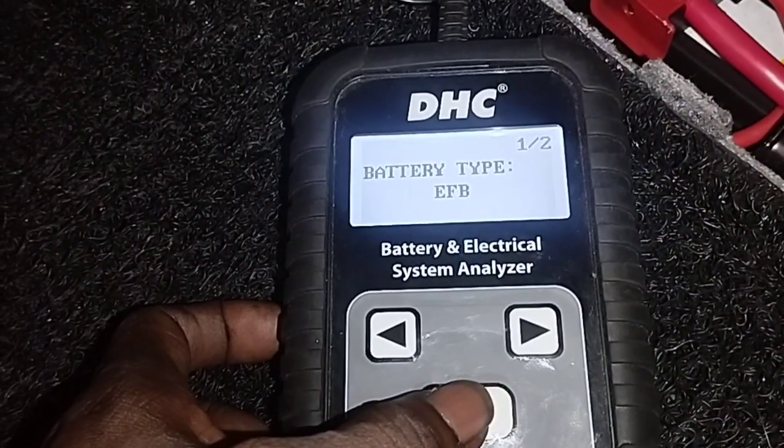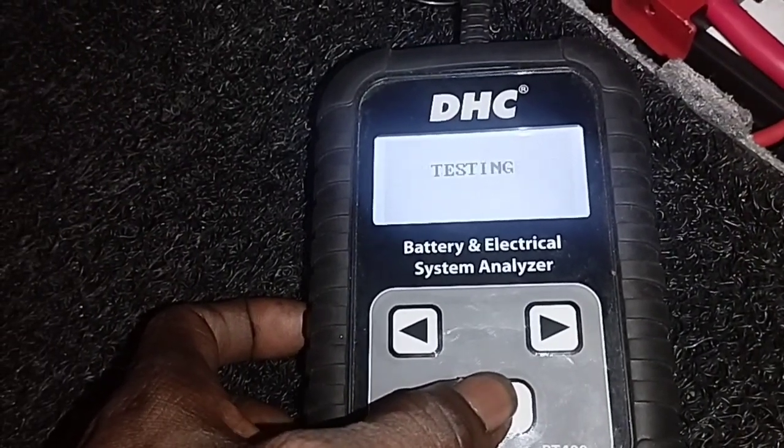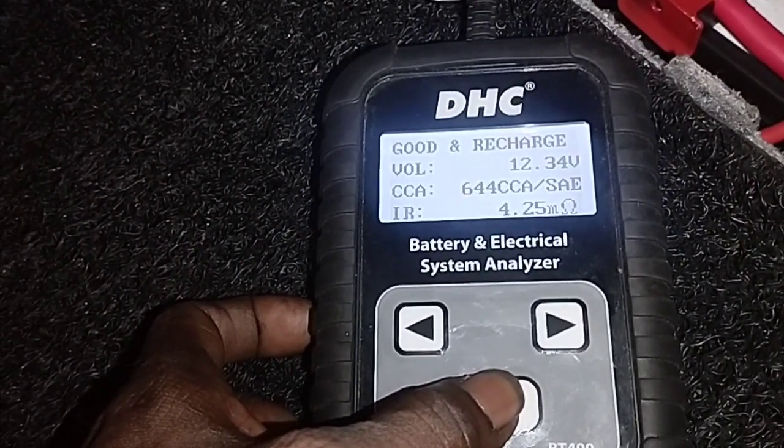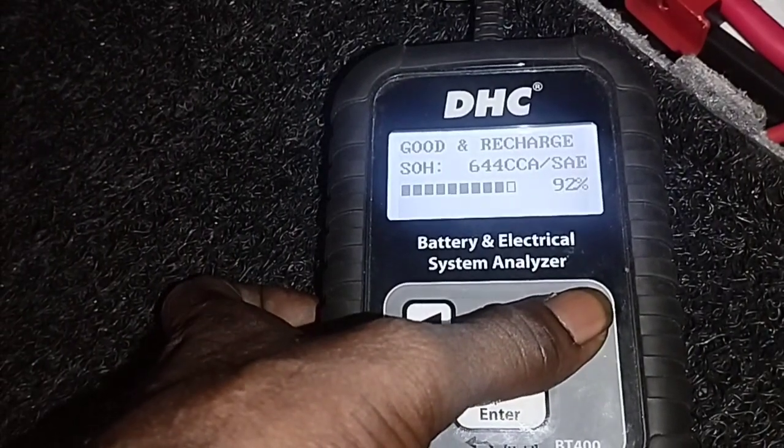It may be that the cable of your car battery has a loose connection. Check it well, and if your car battery is not charged, change it. If the battery voltage is low, then definitely charge it.